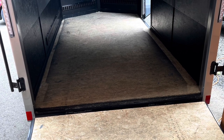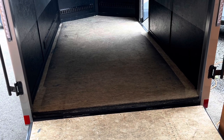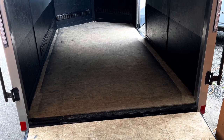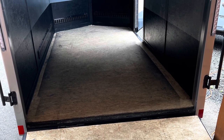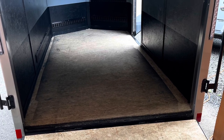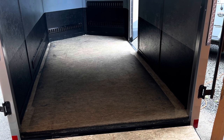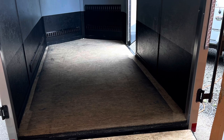I had a little bit of overspray on the floor there around the edges of the Herculiner — no big deal because I knew I was going to be coming over it with a sander. The floors are that OSB product they run in these cargo trailers, and I want to encase this in a candy shell of two-part epoxy, several layers, to make it bulletproof. We do a lot of Seattle riding in the rain and mud, so the whole point of this step is to get the floor and the drive-up ramp encased in that tough bulletproof epoxy.